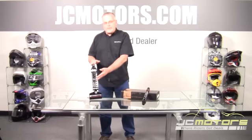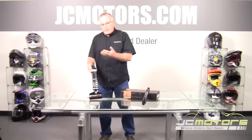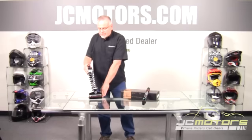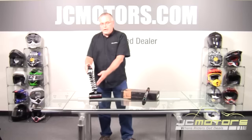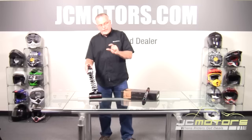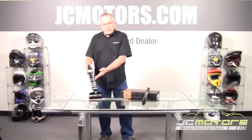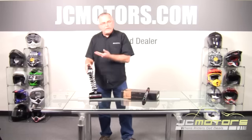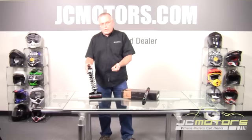What's really exceptional is that we in the suspension industry think and talk in shock length, but you only have the seat as a reference. By virtue of the angle of this shock on a bagger, for every inch of lowering at the shock, that actually equates to an inch and a half at the seat. That's a very substantial benefit — one and a half inches lower at the seat with no compromise to ride. It presets the preload, still giving you full available travel of three inches, while giving you that inch-and-a-half lower stance — the look, with no compromise to the ride.